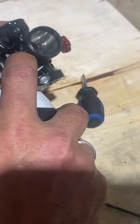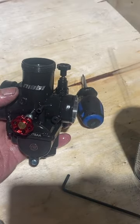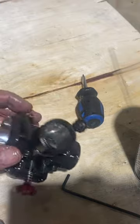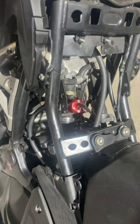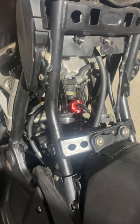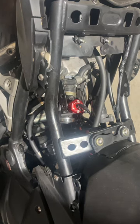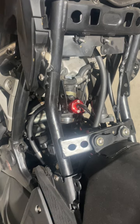Down the fuel line - there we go. Now our carb is all clean. I'm going to go ahead and put it back in the machine and see how it runs. I got my carb in there - you'll see it's still wet because I just literally put it back in. Got the choke popped up, let's fire this up. I'm going to hit it a couple turns on the throttle because there's no gas been moving through there in a while.